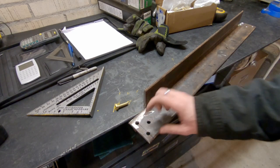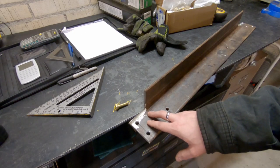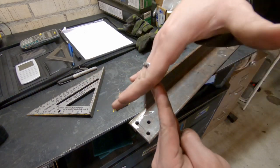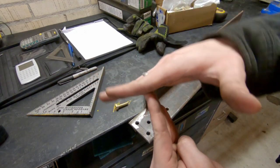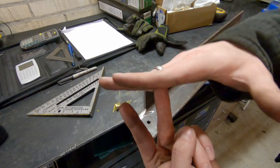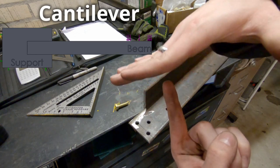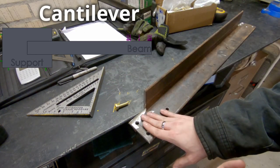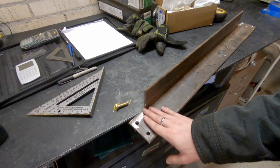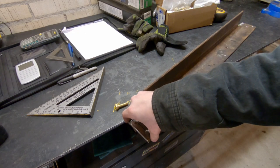Now it's 1/4-inch plate. I think it's pretty unlikely to have an issue, but if it does have an issue, it's going to bend here. Now, if I only had 1 row of bolts, then the plate is sitting on that bolt and it's fixed. It actually still has a lot of ability to bend, but if I have 2 rows of bolts, then when it tries to bend, this part it's lifting up on. So it's a lot closer to a true cantilever having the 2 points rather than the 1, and the 1 point is going to allow a lot more bending in this. So hopefully just adding that 1 extra bolt adds quite a bit of rigidity to this end piece. That's the idea anyways. Now let's get the mounting points on the chassis done up.